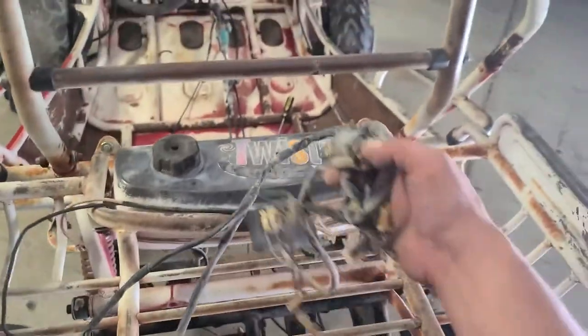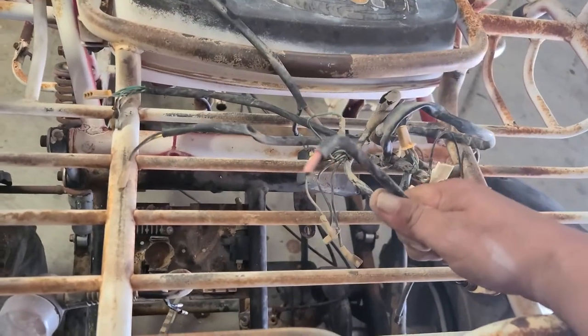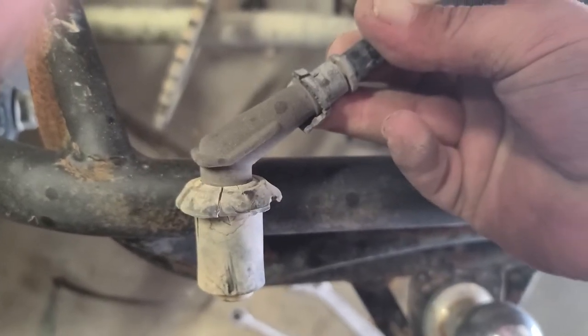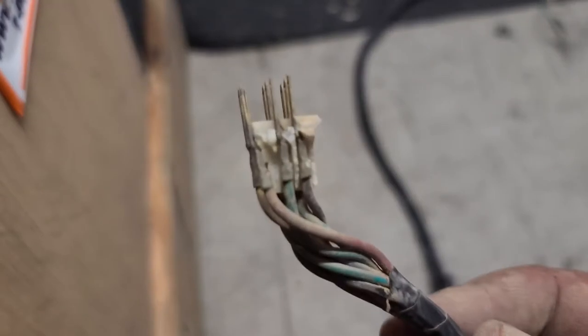As I was saying, this is your main wire harness and you can see it has your coil on it — that fell completely off. I don't think we're getting any spark out of that. It's got your coil connector here and this goes down to the spark plug harness. Here's the little stator CDI box, and then the spots where the other pieces go — you can tell it's been sitting outside. And then here is your accessory harness which plugs in, and unfortunately once again everything just crumbles on this harness — it connects to your main harness right here.